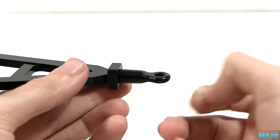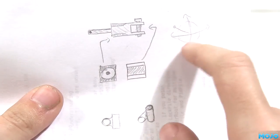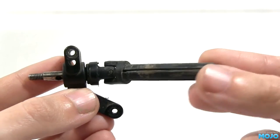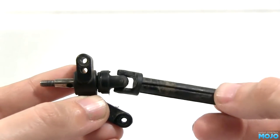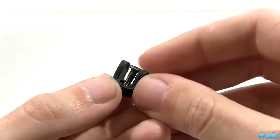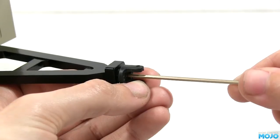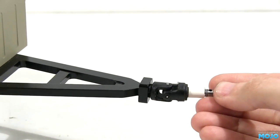So I had a look around at full-size chunky off-road trailer hitches and started to sketch out something that might work. I got this far and realised I'd seen this arrangement before. I had a dig in the parts bin and found a stub axle, universal drive shaft and hub from an old Traxxas Stampede — almost exactly what we want: full freedom of movement, pretty strong and cheap. The first job was to prep the trailer end. The drive shaft was chopped off, then the centre was drilled to 3mm, countered and countersunk to fit an M3 by 16 screw. The eyelet comes off the trailer and the universal goes on in its place. The stub axle just clips in, then there's a bit of plastic tube over the stub as a spacer to take up the space the pin and hex normally take up.